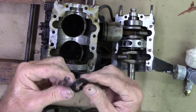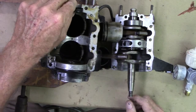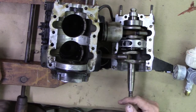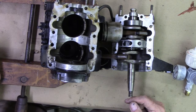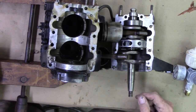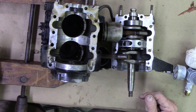This is probably the original 1975 Mercury seal and it's hard. So I had leaks at the top seal and leaks at the bottom seal. The head gasket was okay, and the port covers were okay — the only leaks were at the top and bottom seals. I've got some new seals on order and I'm going to replace them.